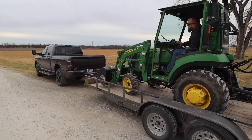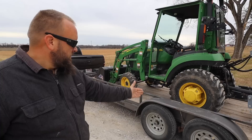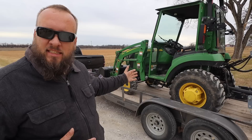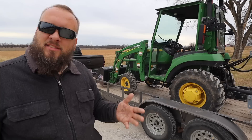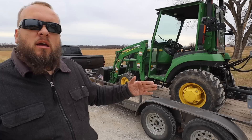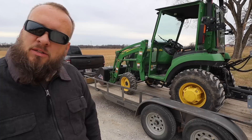I have the middle of the wheel weight centered directly between the two axles — that seems like the centered position. I've been pulling forward another six inches until the bucket hits the front rail, thinking that steadies everything up. But it makes more difference than I realized: adding 300 pounds of tongue weight means the weight is too far forward. Not a huge deal with the amount of weight I'm pulling, but good information. Let's get it strapped down and see what it actually weighs.